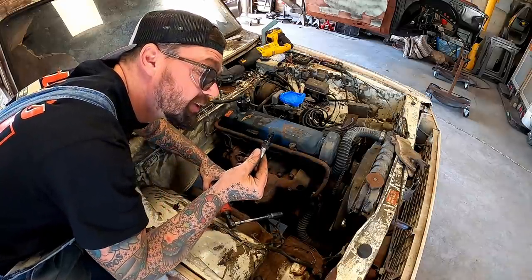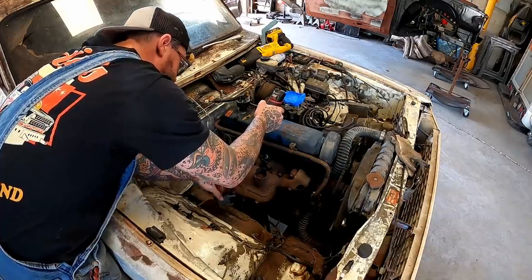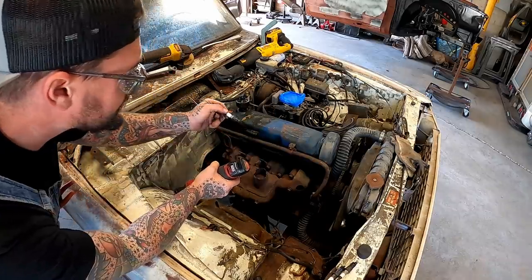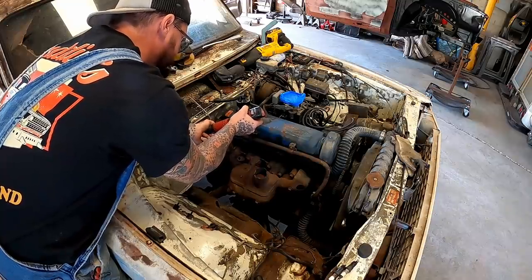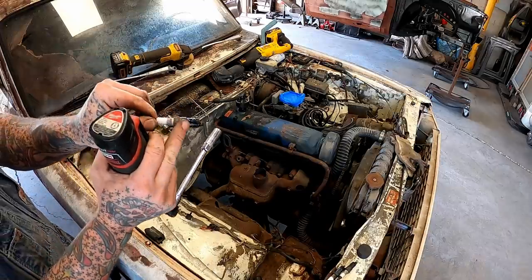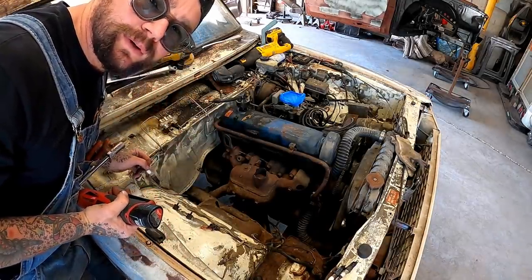Survey says she looks good. A little bit of carbon buildup. Number two. She will do. She's a little dirty. Number three. Looks dirty to me. And good old number four. You look pretty good. The oil around her, thus supporting my theory of an oil leak.